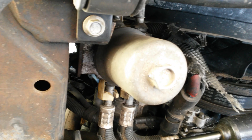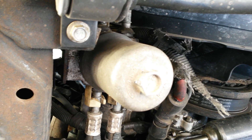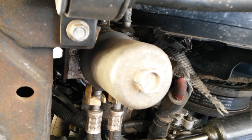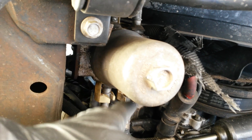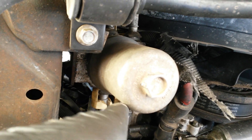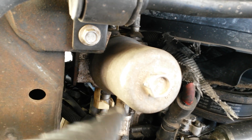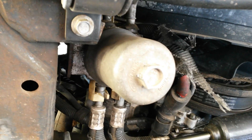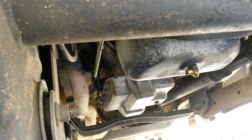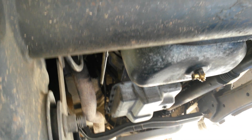The bypass filter is only getting a small amount of fluid that just happens to make it through and back into the system. It's not full flow — meaning the fluid is not forced through the filter and then on to the next step. It only sees a small amount, and it's up to the filter whether that small amount goes back into the other side of the system or not. On a Super Duty truck you need to be filtering your fluid 100%.